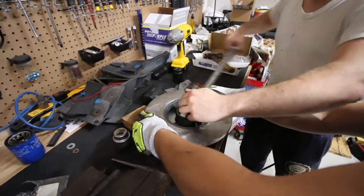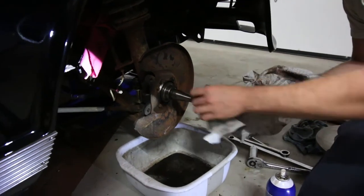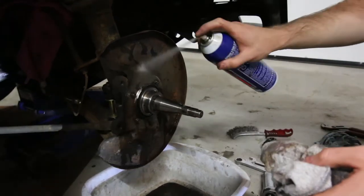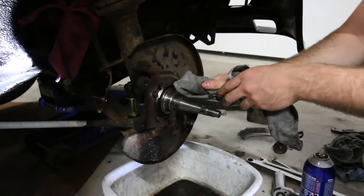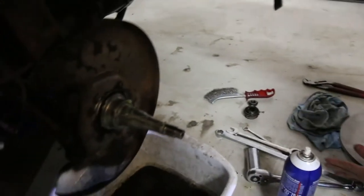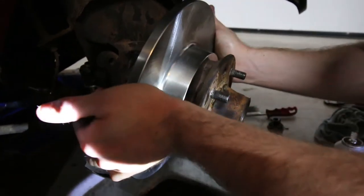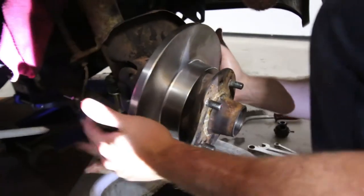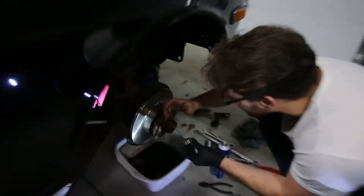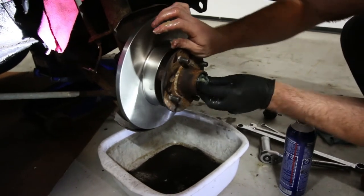So we're just torquing the rotor bolts. I can't remember the exact torque spec, but I believe it was between 29 and 39 foot-pounds. Once you've got the rotor and hub mated back together, we're going to clean up the spindle on the car and add more grease. Once again we're adding more grease. So I'm going to slide the hub and rotor onto the spindle, then grab our packed outer bearing and slide it on. Then we're just going in the reverse process of what we did to get the hub and rotor off the car.